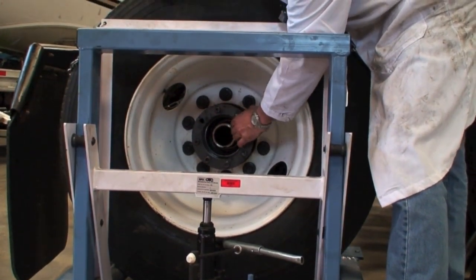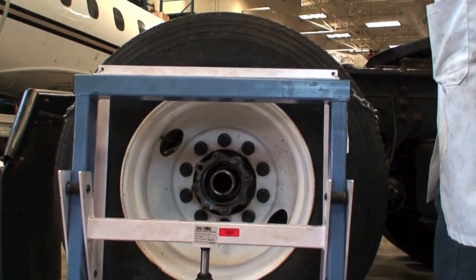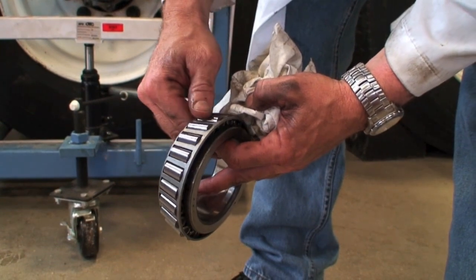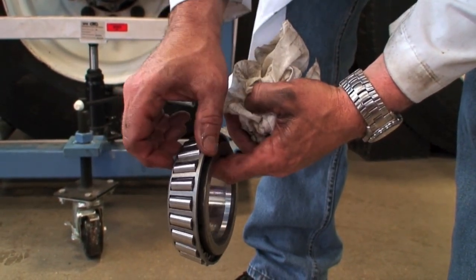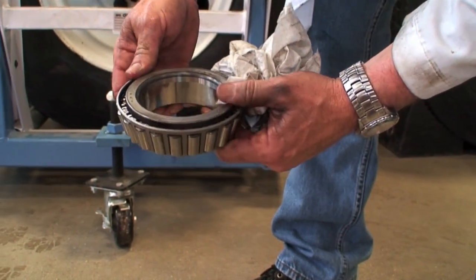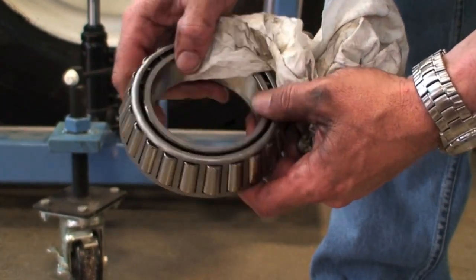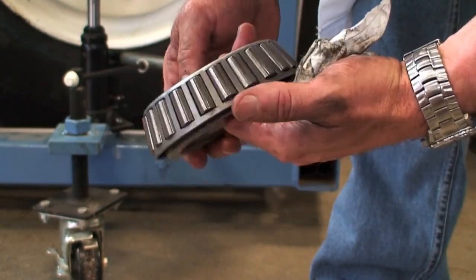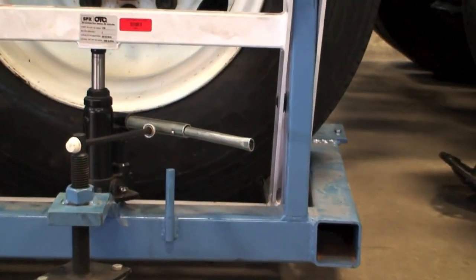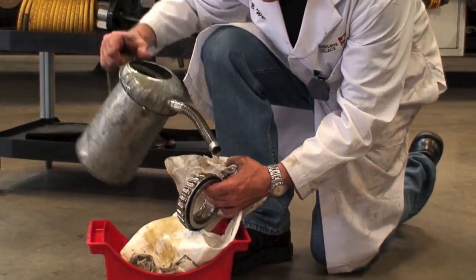New gasket here — axle flange gasket. We'll take that off for the moment. We'll always use a new gasket for your axle flange. Now we'll take our wheel bearing. We've inspected our wheel bearing already and it looks good — there's no major pits in there, nothing that's going to damage it. We can look at the end of the rollers, make sure they're not worn. Have a look at the cage, make sure it's in good shape all the way around, not grabbing any of the rollers. And the inner race, to make sure there's no pitting inside there. We'll give it a slight spin test just to make sure it rolls nicely, and now put a little bit of lube on it — some gear oil. Just put a bit on there and that's all pre-lubricated, ready to go.